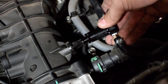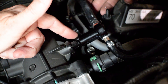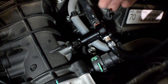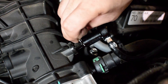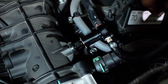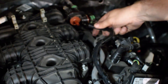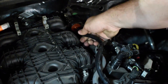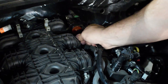Now we've pre-assembled our boost reference adapter and silicone hoses. Slide the boost reference adapter back over the same area where you disconnected the EVAP system, and pay particular attention to install your retaining clip. The next step is to connect your reinforced hose back to the EVAP system's check valve. Note that it's a very tight fit — there is no clamp required. The barb fitting on the check valve will maintain the condition of the hose.